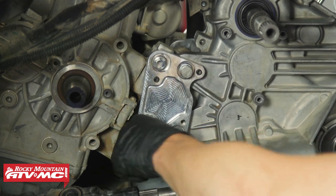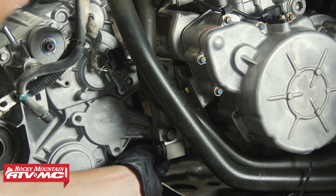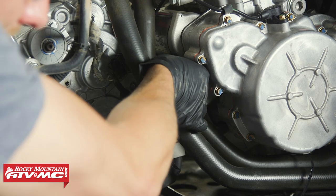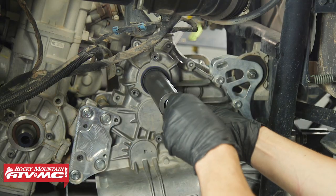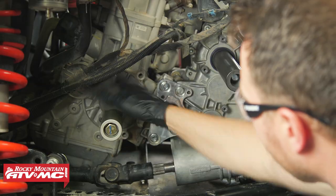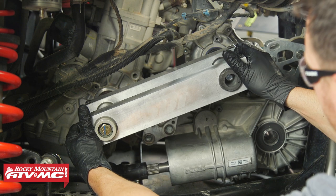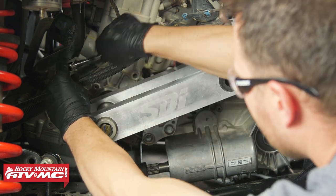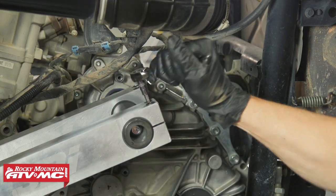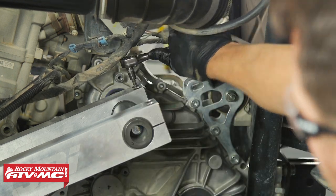On the right side, we just have a nut plate on the back side and two bolts going through the side. With all transmission mounts loose, we need to set the distance from the crankshaft to the transmission input shaft. You can use a distance tool from Polaris or the SDI alignment tool — that's what we're using since we have that motor mounting plate. These bars make sure that the shafts are parallel and at the correct distance. If you need to know how to use these alignment bars or motor mounting plate, we have a separate video for that.